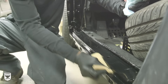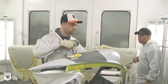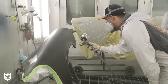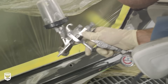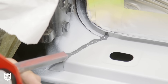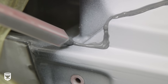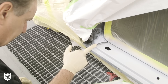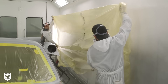Before the remaining pieces get primed, Lurvin — another J&B veteran — lays down a light coat of rust prevention sealer on the newly exposed areas of the frame after the last round of sanding. The guys also added epoxy sealer in the seams of the frame to prevent any water from slipping behind the metal and potentially rusting again. Like I said in the last video, this car could literally be dropped in the ocean and not rust.